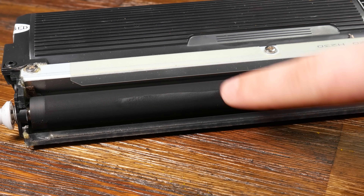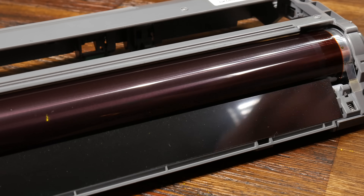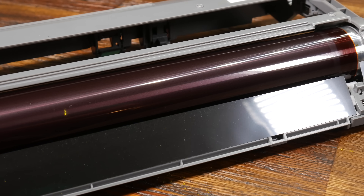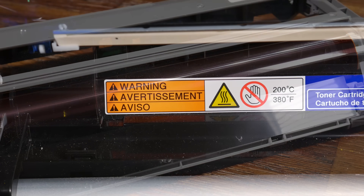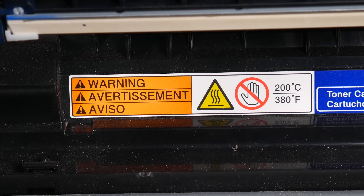Now if you've never heard of this before, I wouldn't blame you. Fundamentally, LED printers are the same as a laser printer. They still use powdered toner rather than liquid ink. They use photosensitive drums to transfer toner to paper, along with corona wires and other charge-inducing or -destroying components. A fuser melts the toner onto the paper, so a tall stack of freshly printed pages is nice and warm. But where they differ is in how the image is drawn on the drum.